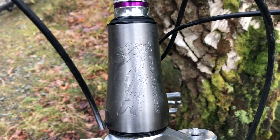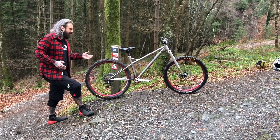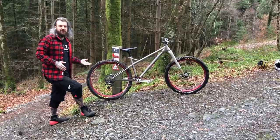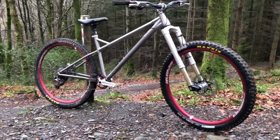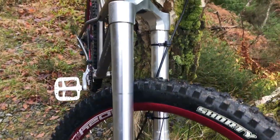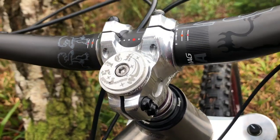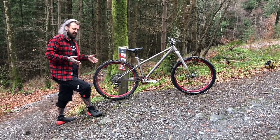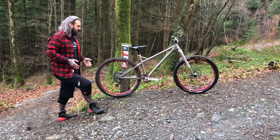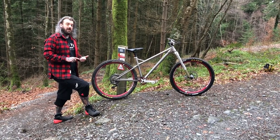So we reached out to a few friends and asked if anyone wanted a titanium bike, and this was the result of that experiment. Apart from one thing, I think it's a case of right first time really. Our current range — the Shrike, the Sesh, and probably Death Wish — all come just from this frame. The only thing we've changed is the downhill bottom bracket; the reason we had it at the time was there was no way of getting the tire clearance we wanted.